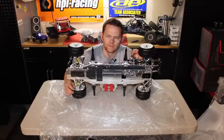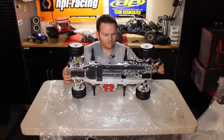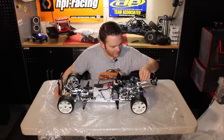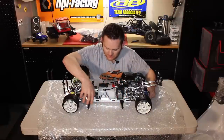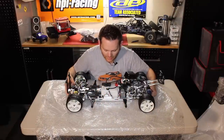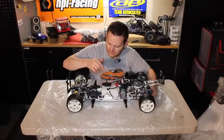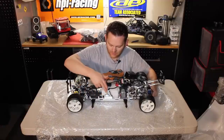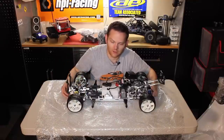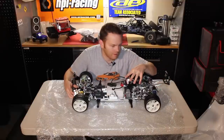What FG has done is this is a mostly assembled car kit — they've rough assembled it for you. We have to go through it and thread lock all of it. They leave a few things for you to complete: assemble and install the differential, assemble and install the tuned exhaust muffler, and there are hydraulic brakes with two master cylinders, one on each side of the fuel tank. You also need to assemble the brake line to the hydraulic brakes and bleed the hydraulic brake system, install the front bumper, and install the air intake system.